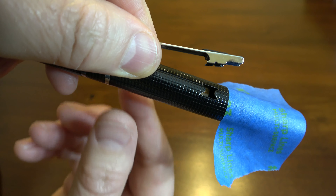Let's go ahead and put this back together. This lens cover piece — make sure it goes in the proper way. There's actually a beveled edge, so the thicker part goes inside like this. It's kind of snapped in. Now the lens cover is inside the clip. You see this tiny hole right here? That hole is meant to receive the post on the thumb slider.